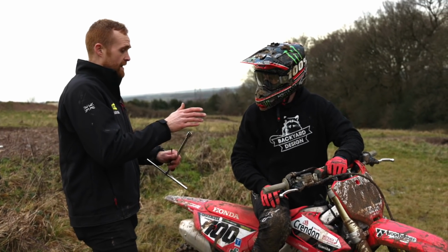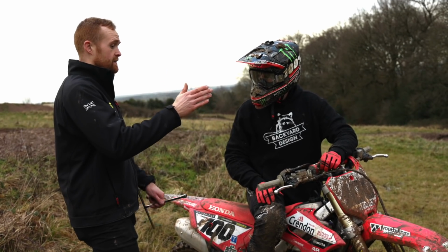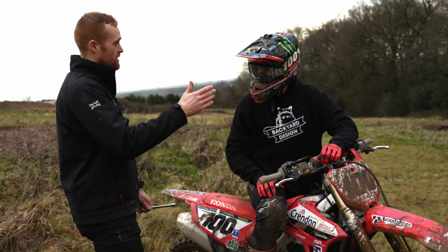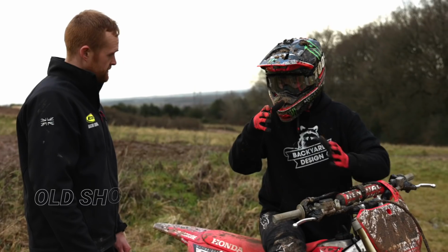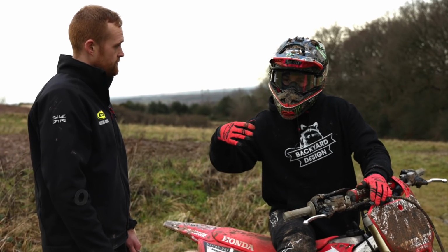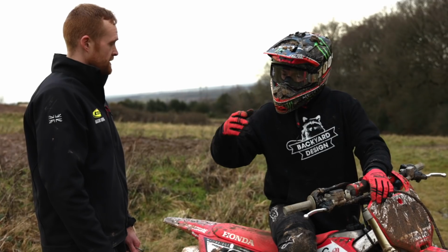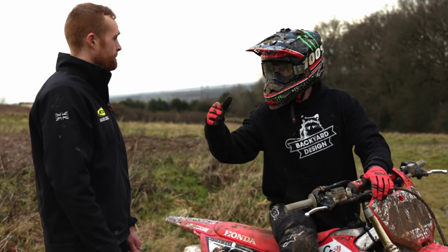So I've taken the rebound out, because what you're getting is you'll go along and you just sit, and then it just needs a little bit more travel. That's when it starts swapping. Yeah, it's more nervous on the rear now than it was before. It was quite stable on the rear, but it would go in and then it wouldn't come back super fast. It'd go in and sort of spring out. Yeah, more like a pogo stick motion, where now it's faster, like a shake.